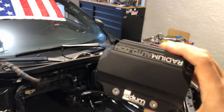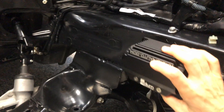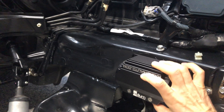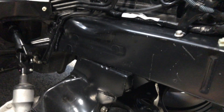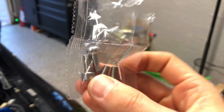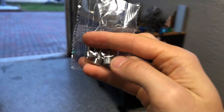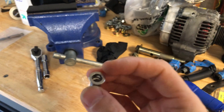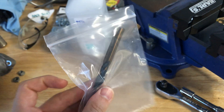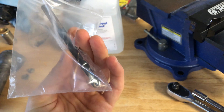This is the perfect moment to get our filter housing installed. We're going to place it somewhere around there, attached to the frame rail. The way we're going to attach it is using these bolts provided by Radium and a rivet nut. It's an M6, so the drilling hole size is nine millimeters — I just bought the drill bit from Amazon, I think it was about ten bucks.